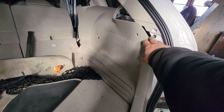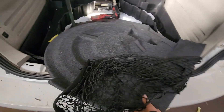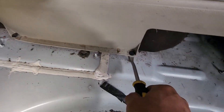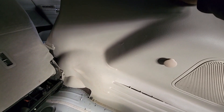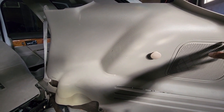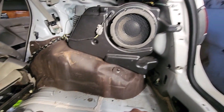Remove this plastic, then remove this side — this is going to be the passenger side. Remove the spare tire cover; after that there are going to be two clips, one and two. At this point you can remove the entire panel and move it to the side. In this case, set it behind the back seat like that. Now you can see the subwoofer right there.